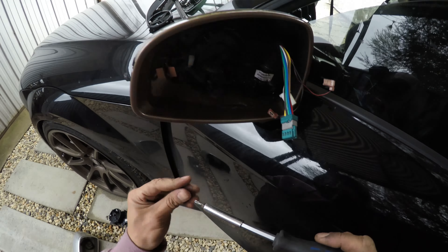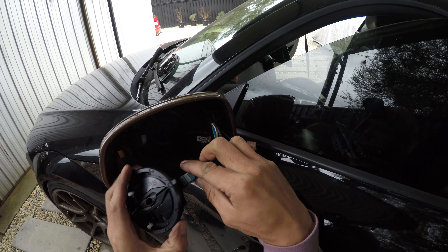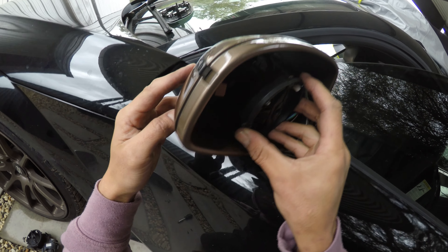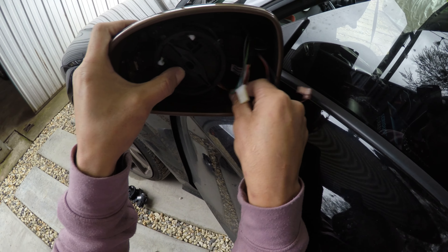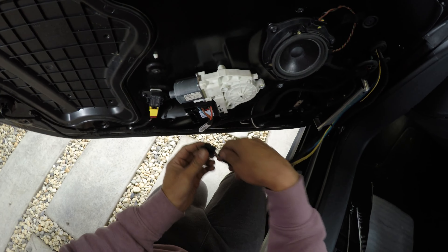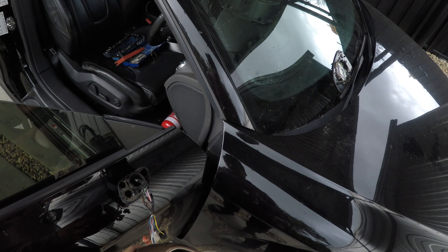Secure the mirror bracket to the wing mirror housing. Install the auto reverse dip motor with your new plug — that should just push right into the housing — then you'll be able to give it a good test with your mirror controls, which you'll also need to swap. Here's the other side which has better light. I'll leave the video playing for anyone who wants to see the detail for where everything goes. And remember to swap over the mirror controls too.